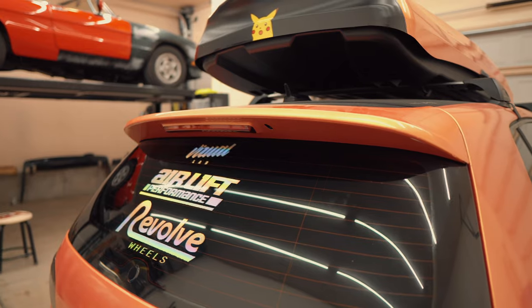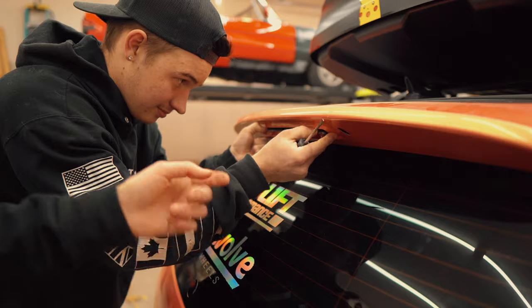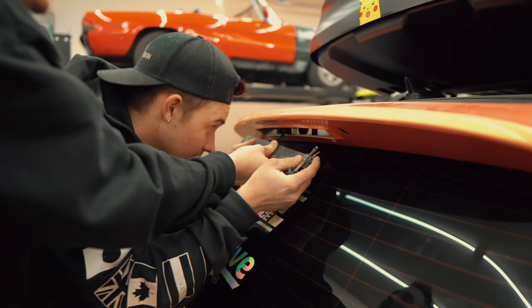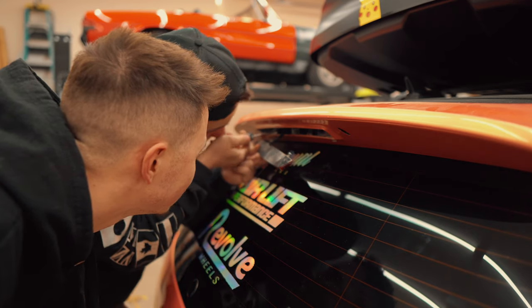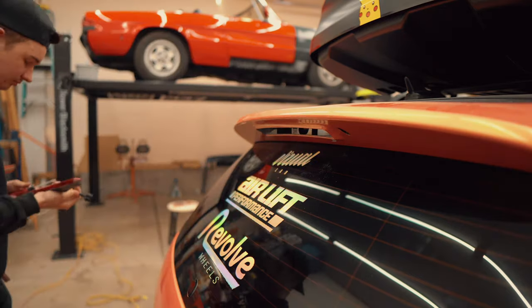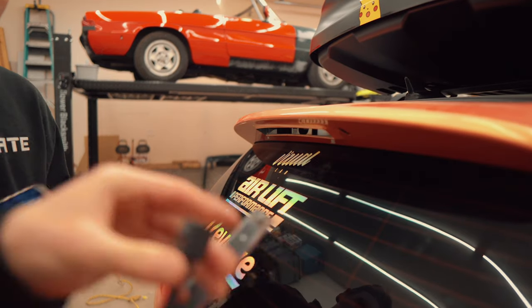Let's get into it. Step one of the surgery process: there are these little silver tabs that you pull down with a screwdriver on both bottom corners. You saw Jordan just dig that screwdriver in the little groove in the center there to remove the third brake light. There's a tiny little clip on the inside there. Clips are still on the bottom — you can see one right there and one on the corner there.